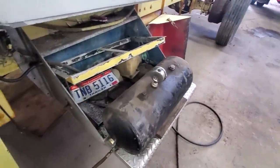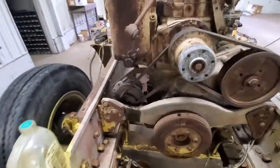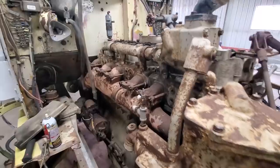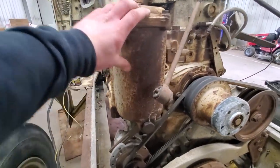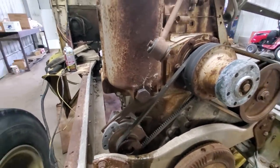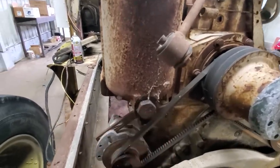We've got our tank and we ran oil through it. After we pulled the drain plugs out there was some water in it. We pulled the valve covers off, we're going to dump some oil in there and get everything lubed up real nice. This thing is old enough that it doesn't have a spin-on oil filter — it has a cartridge style. We pulled this plug out and there wasn't a whole lot of water in it, but there was some. Whenever we ran all the oil through, we pumped it till clean oil came out.